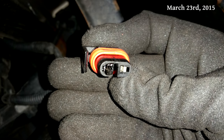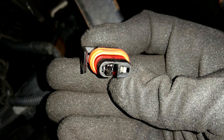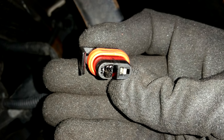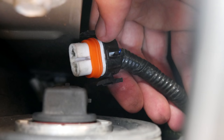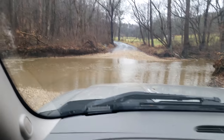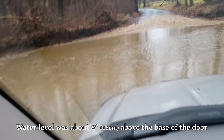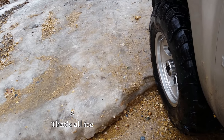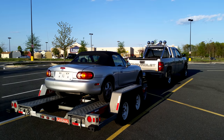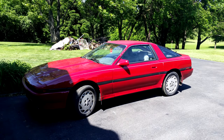One day the passenger side headlight just stopped working. I unplugged the connector and found that it had melted — something about how enclosed it is or maybe some weird wiring thing, but I did find other reports of this online. I simply replaced the connector with a ceramic one intended for HIDs and haven't had any more issues. The truck treated me well for on-road and off-road driving, as well as going through some water that was definitely deeper than what I should have driven through. Throughout the summers and winters it happily served as a utility vehicle. It also ended up towing a few more vehicles including multiple Miatas, a Supra, and an S10 Blazer — it seemed pretty content to put up with all the crap I put it through.